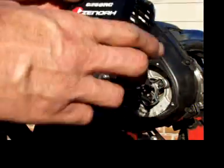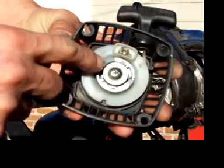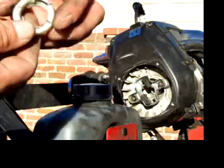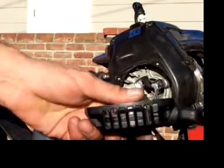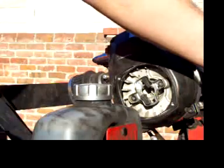You don't have to do anything fancy. I actually did these with a drill, just carefully, just went outward evenly till they matched. Also installed a metal pawl on this particular pull start, but I've tried it on the bench with the plastic ring also, which works just as effective. So let's put it together and see what happens. I'm going to install a piston stopper.